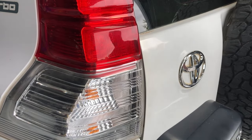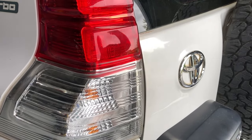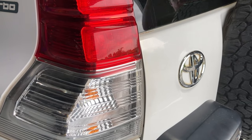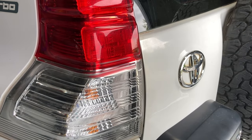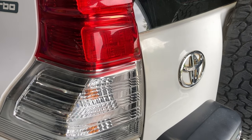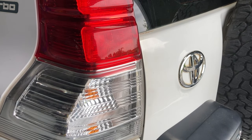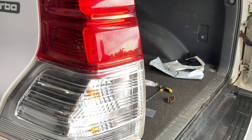Maybe not the best — maybe the door's bent. When I push the top back corner at the driver's side it doesn't go in much, so there's a stopper up there that might need replacing. The driver's side doesn't move of course — that's the hinge side. Then you've also got the other problem: the spoiler is quite loose and rattly as well, so we'll have to do another video on how to get that off once we work it out, because there's no videos on YouTube for it. Anyway, thanks for watching — hopefully you learned something and you can make yours better.